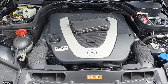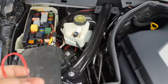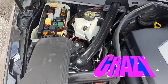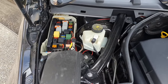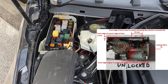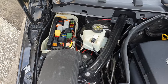Now let me show the other way to try if your steering wheel is locked. You would do the exact same thing and jump start your car — that's why I always keep the jumper cable inside my fuse box. This only works when your ESL has failed in the unlocked position, because your steering wheel needs to be unlocked. If your ESL is locked, you can start the car but you won't be able to go anywhere.